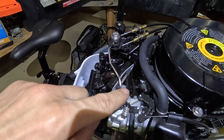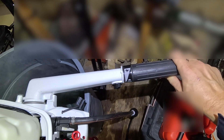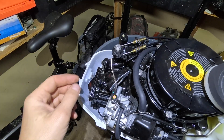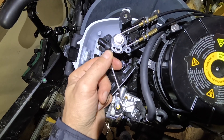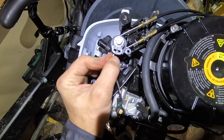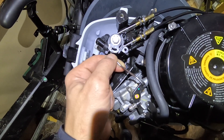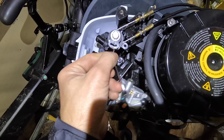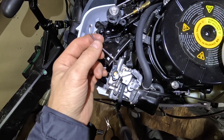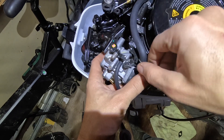In order to remove the throttle piece, you're going to turn your throttle about three-quarters of the way. Once it turns three-quarters, you'll see it's easy to align — there's a little hole. Slide the metal piece so it aligns with that hole in the middle and just push it downward, and it comes out just like that. Very easy. Probably should have removed this first, but it doesn't really matter.